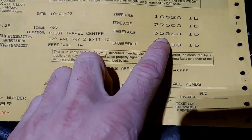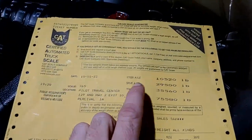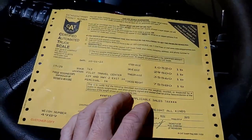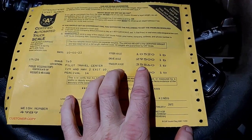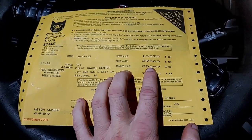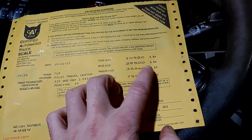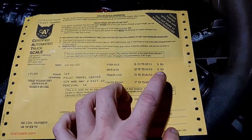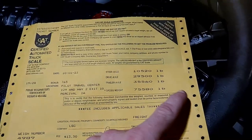A few days later — and I've got a cold now — I had an opportunity to go back and look at that scale ticket, and I realized I made a mistake. The trailer axle was over, so I didn't want to slide the axle forward, because what I ended up doing was making the trailer even heavier when I went across the DOT weigh station scales. Interestingly enough, they didn't pull me over even though I was almost 2,000 pounds over. Even though I slid the axle forward — which should have made it heavier — it wasn't. It was about the same number, which is interesting. I actually wanted to slide the axle back even more, so having it preset four holes back did help me; I just needed to move it even further in order to be legal.